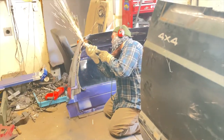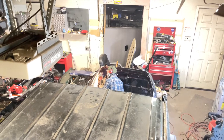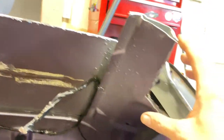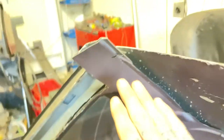So we've measured about 150 different directions, figured out where we want everything to fit. We still have the structural integrity of the overhead system built into that B-pillar. We're going to be creating this B-pillar by grafting it all into it. Over here, we've taken a lot of measurements. We've cut everything back slowly until we have it exactly where we think we need it.